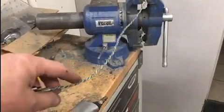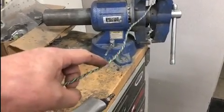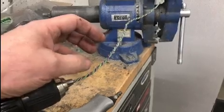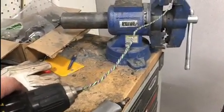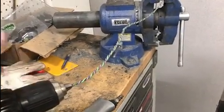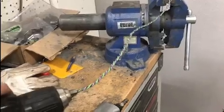And it is important because the two wires, by being a twisted pair, are shielding the signal that's in them from other sources of electricity or interference. So if you're duplicating a twisted pair, you do want to make sure you put a twisted pair in there to duplicate that.